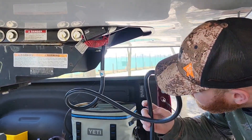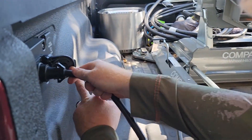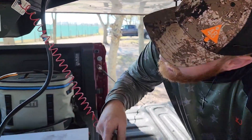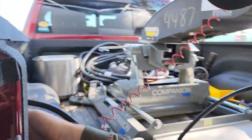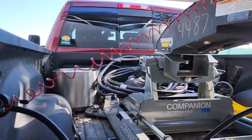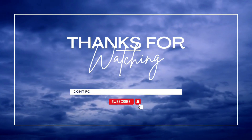Once you know you're connected, get under here and go ahead and connect your seven-pin — that's for your lights. Before you take off, have your significant other go back and check all the lights. Also connect your breakaway cable. Worst case scenario — god forbid this never happens — but if you come disconnected from your truck, this is going to snatch and lock up your trailer brakes so you don't have a runaway trailer. Nobody wants that.